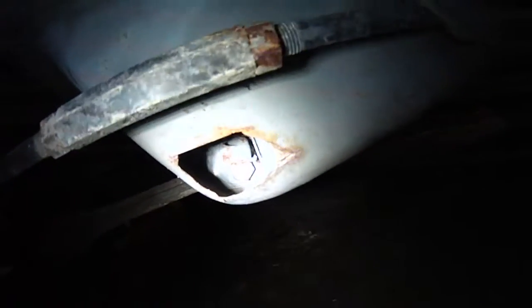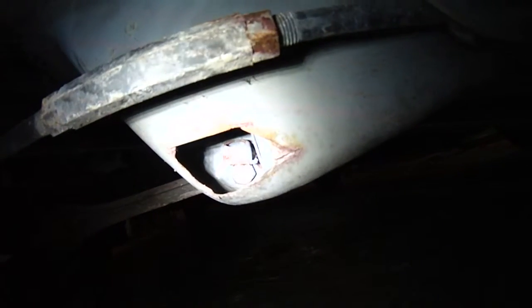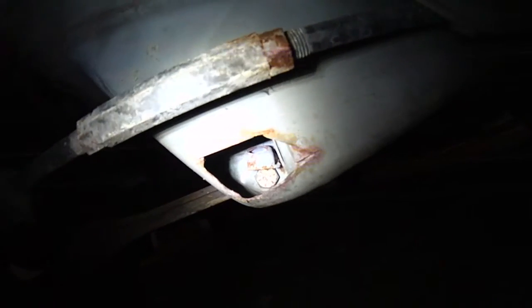The wheel wells. Get some sort of undercoating done. There's your exhaust. This right here was a repair that was done because a nut inside there, if you can see, there's like a weld nut in the subframe. It had stripped out in a previous owner, so they cut it out and they put a bolt in. I then replaced it with a grade 8 bolt. I've been monitoring that and it's been holding up pretty well.